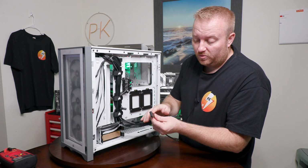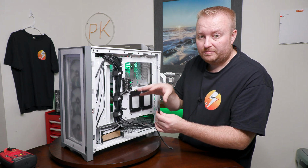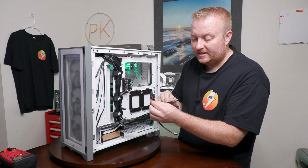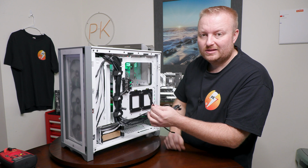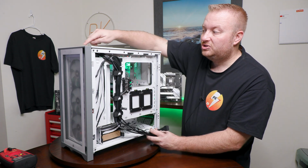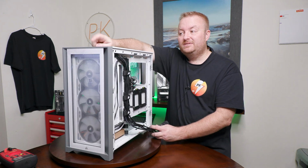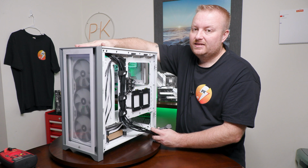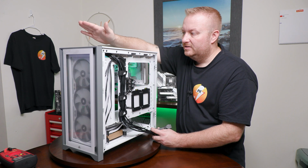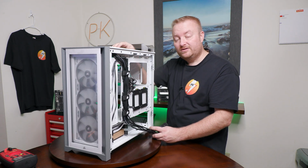So something else I wanted to point out, this 3.0 connector, your motherboard can actually supply 2 USB 3.0s in this one connector. And this connector more than likely already has the wiring built into it for 2 of them. But they cheap out and they only give you 1 of the USB 3.0s up top here. It's a lot nicer if they just spend the extra $3, $4, $5. I'd pay that much more to get that extra USB port up there, but they don't do that.